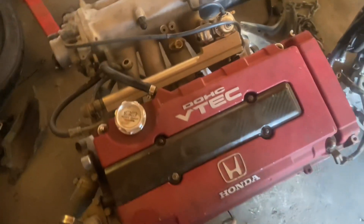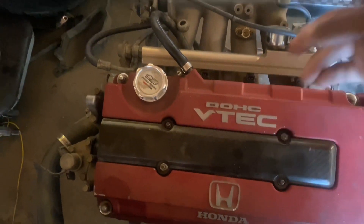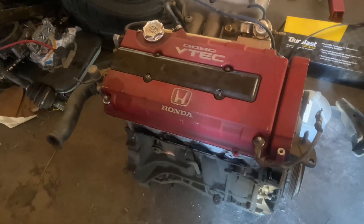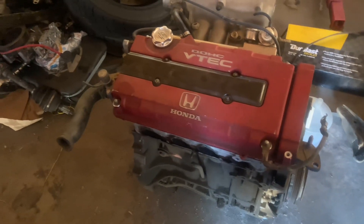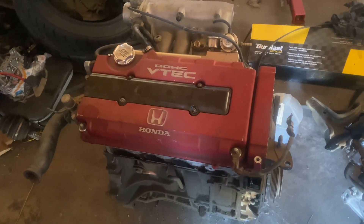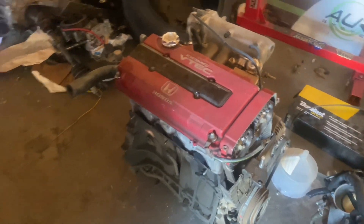I will be installing some breathers on here. For people who don't know, B20s have a breather coming out of the valve cover, and the GSRs and B16s have a charcoal box. That's one reason why you want to run a breather on LS/VTEC and B20 VTECs, because the positive crank pressure will have to go somewhere and eventually start going through the rings, so it'll have a little smoke coming out of the engine. I'll show you exactly where the B20s vent and the reason why the B16 head blocks it.